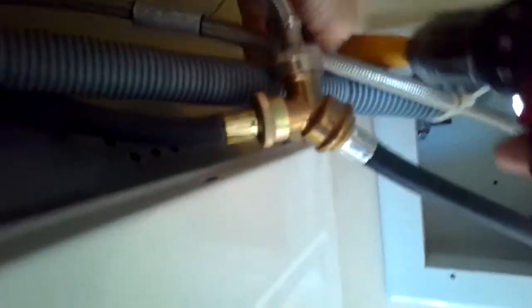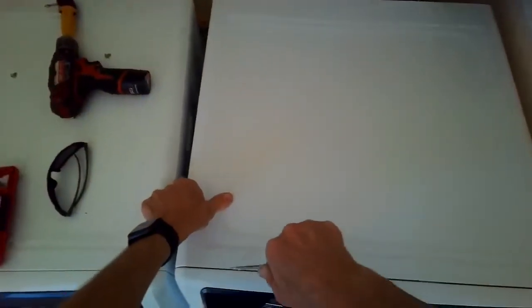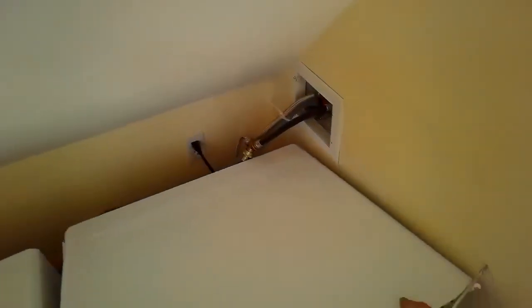We unplugged it and we're going to take off the top panel. There are two Phillips head screws on the back in the upper left and upper right hand corner. Pull out those screws and then push back on the upper lid about an inch to two inches, and you should be able to lift off the top lid. Sometimes they're kind of stuck and you can take a flat head screwdriver and pry a little bit here in the front to get it to move back.